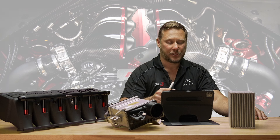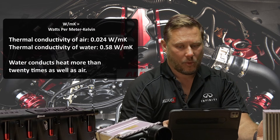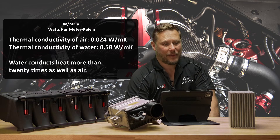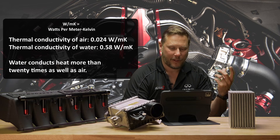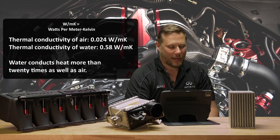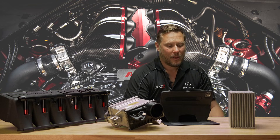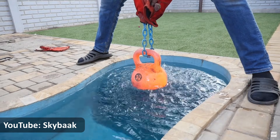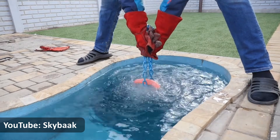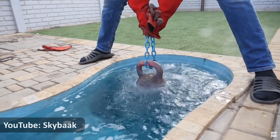So that's some different applications. The big reason air-to-water intercoolers can physically be much smaller is that water has a thermal conductivity 20 times that of air. You put a piece of metal into the oven, pull it out, and let it sit on a countertop — it's going to be hot for a long time. It takes a long time for the air to cool it down. Whereas if you dunk it in water, it cools it down really quickly. That's the reason why — it's 20 times greater the thermal heat conductivity of air, so you can make the intercooler a lot smaller.